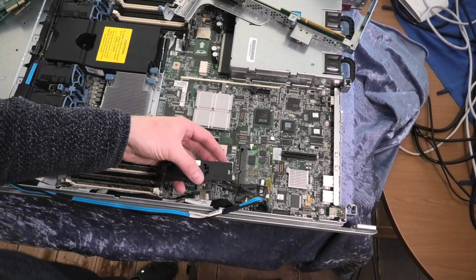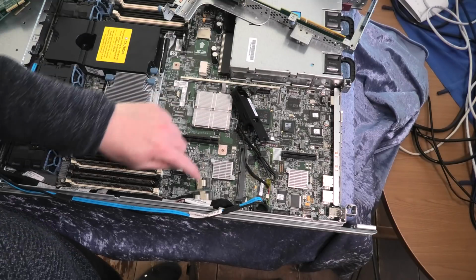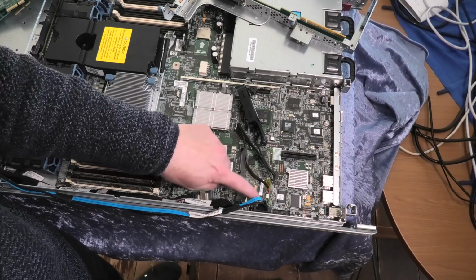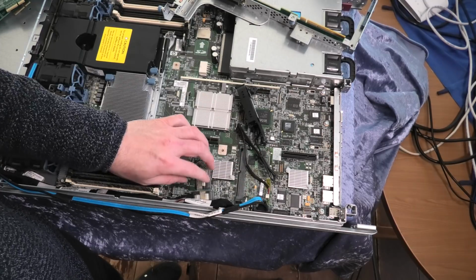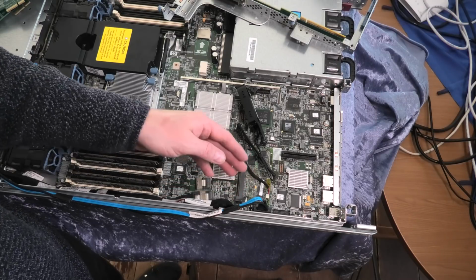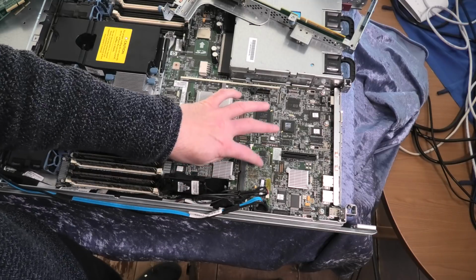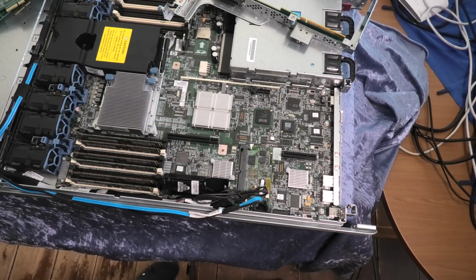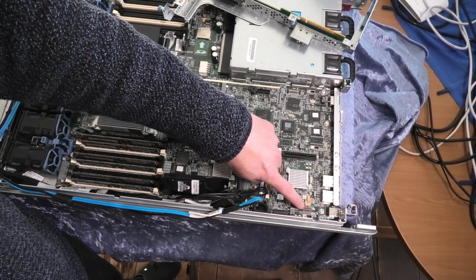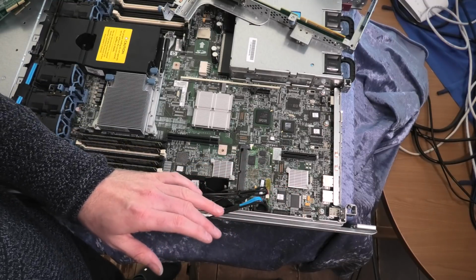And the battery sits on top of that plastic. And the leads are definitely long enough. And it has the connections. So there is the controller on the system board, and then this is an expansion for that. So you have the discs available without this thing, but when you put this thing in, you can do more stuff with the discs, like RAID and better RAID and caching, 512 megabytes of caching, and that speeds up everything. I have a very big dip switch over here. I am so happy that we don't have to mess with those anymore.